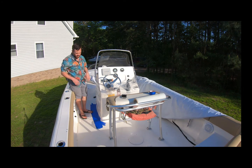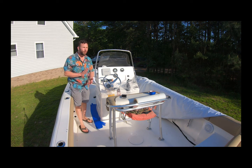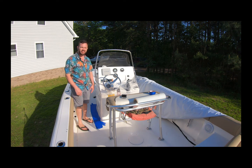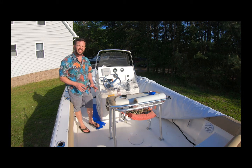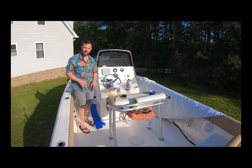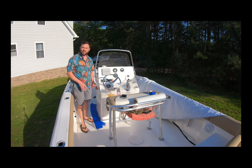All right, let's talk about one of the topics when we talk about placement and where we're going to place this. I've heard horror stories about these kits. People put them in and they break, the welds break. Nine times out of ten, not intentionally or unintentionally pointed at the installer, what they ended up doing is not bolting this to a level surface. If your floor is not perfectly level, then you're going to have to shim that unit. It is made to work on a level surface. That is one key point to remember in placement.